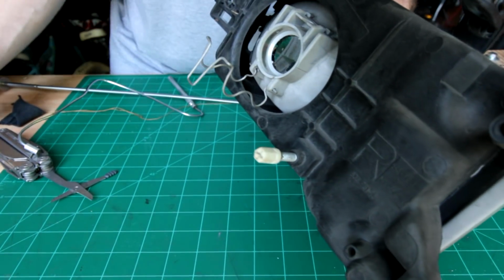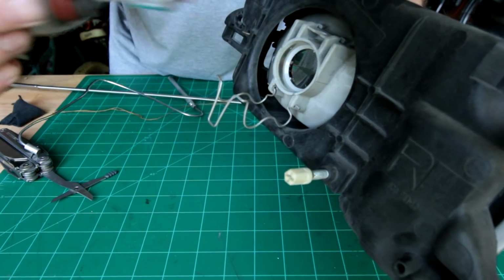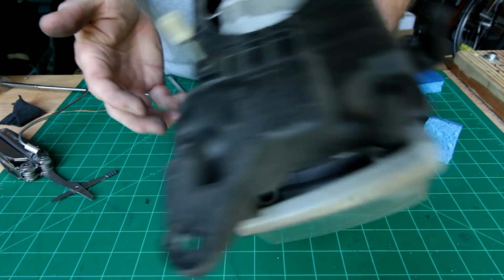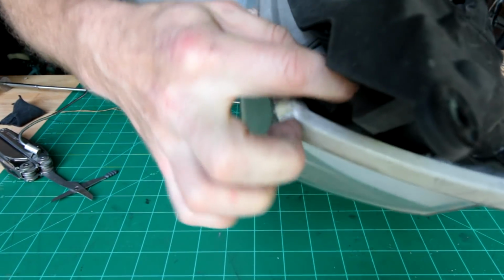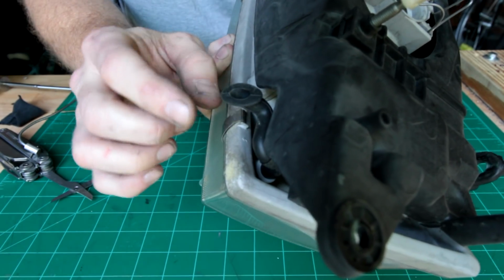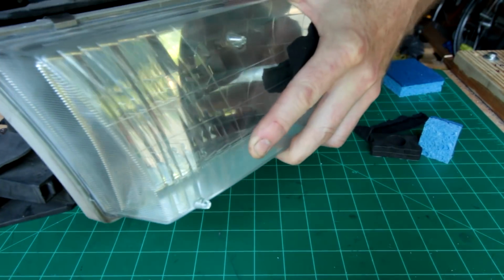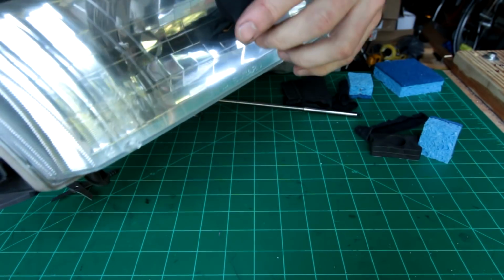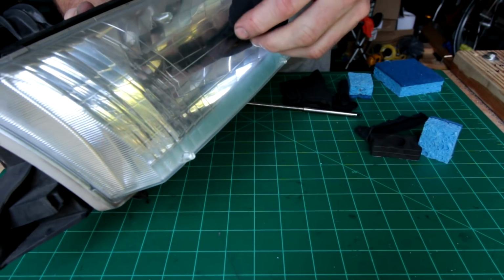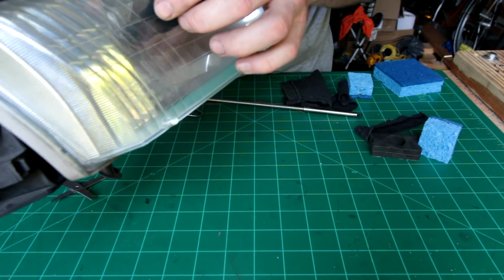And your actual headlight itself has got a little rubber gasket on it, so in the back it's supposed to keep out some moisture. But the headlights are made so that they breathe, so they're not completely airtight. On this headlight you can see there's a little rubber boot sticking out the bottom. And that actually has a hole on the inside that vents the air, so if it gets hot and cool, it lets the air vent out. Well, what happens is it sucks in outside air, so if there's any moisture, dust, grits, and grime in that air, it's going to get inside the headlight.